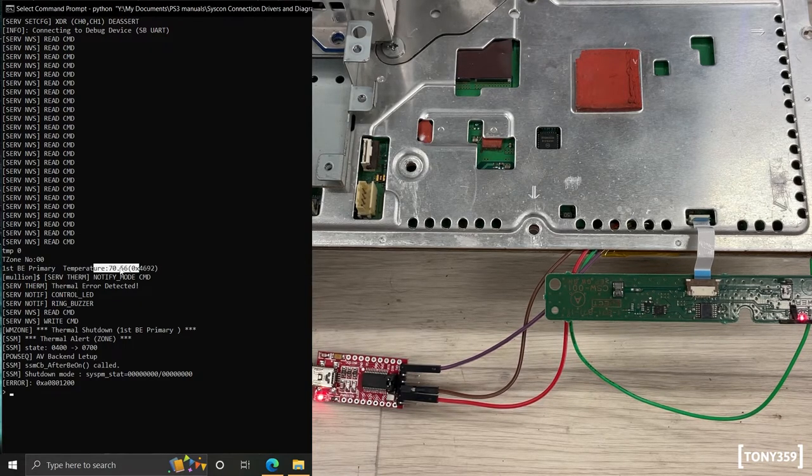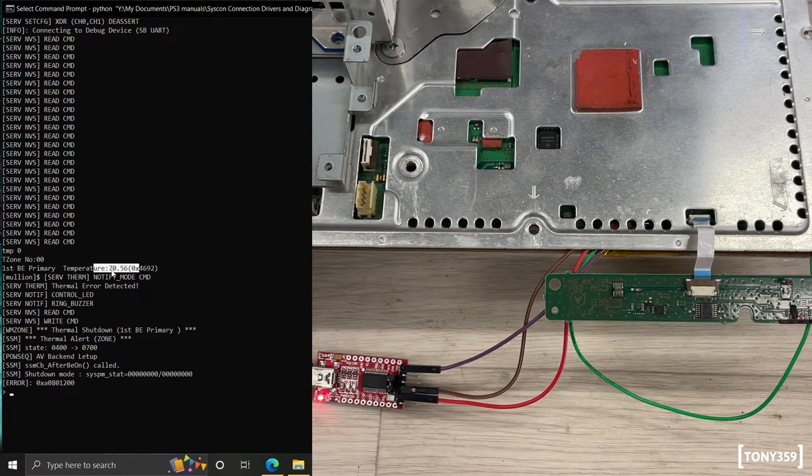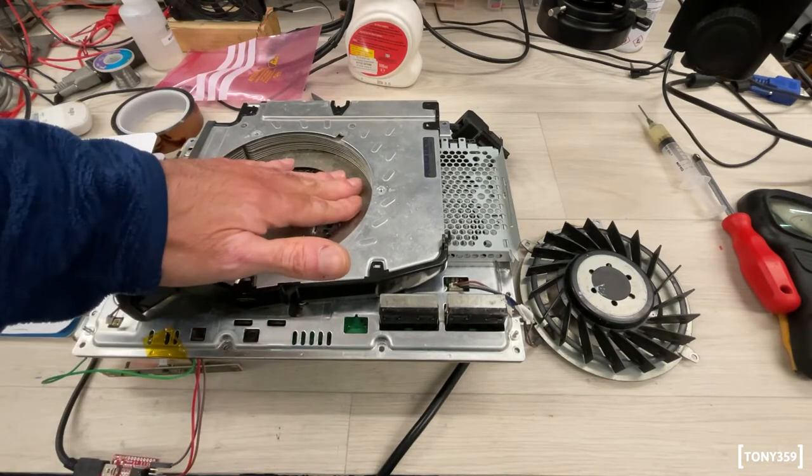I don't think a temperature sensor fails reporting random wrong temperatures - it would report a fixed wrong value. Every time I try I get a different number. This is telling me the circuit is working, the sensor is working, and the chip is actually getting hot. As much as I feel it's unlikely, I just need to remove the IHS heat spreader. It's not something I'm happy to do because it's not easy on the CPU - on the GPU it's much easier. But that's where my diagnostic has taken me.